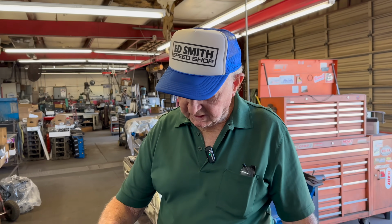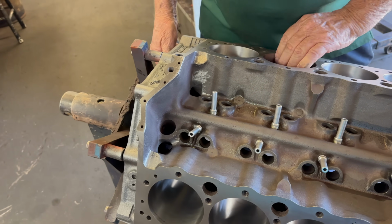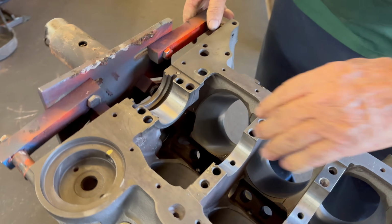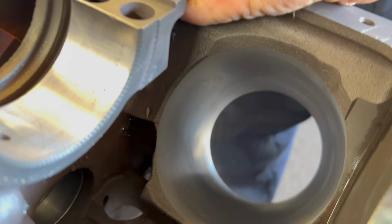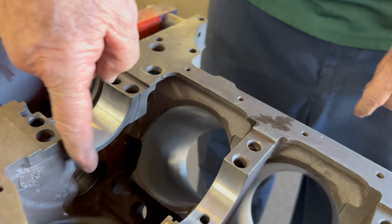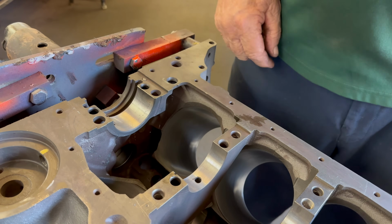Okay. So let's go back to the oil then. Yeah. The oil's going to go down that hole. Yeah. So okay. Now it's going to go down in the engine. I'll turn the motor over here. Let's see where it's going. It's going to come out in this area right here, come down here. Right. Okay. Then it's going to hit this flap. Okay. And then it's going to flow out over this, and the crankshaft comes around, the counterweight hits it and throws it up the cylinder wall.